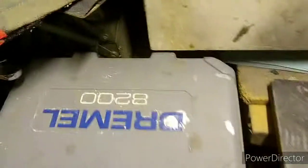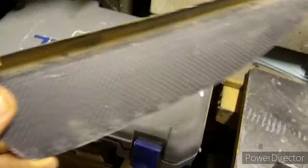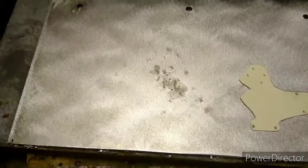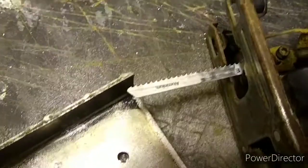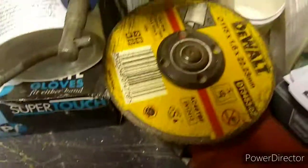I've had a look around the garage for various bits and pieces. I wanted to use some carbon fibre but I didn't have quite enough, so I'm going to do it with some aluminium checker plate that I've found — nice and strong, it's probably about three millimeters thick. I've sanded up the back surface so that the pencil marks stay quite nicely on it and I can cut it out accurately. Part of the reason I've chosen aluminium is I've got the correct cutting blade for a jigsaw for aluminium, and the correct cutting disc for the angle grinder.